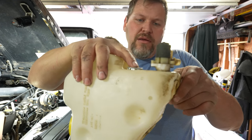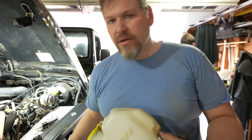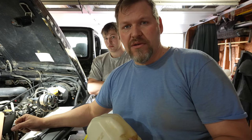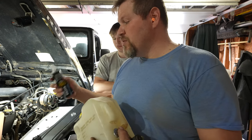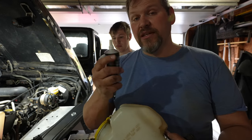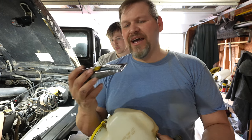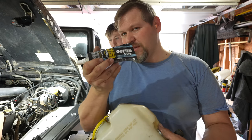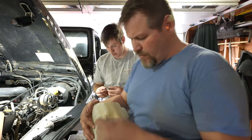It's about ready to pop in, but we need to seal it. We don't know whether to use silicone or JB Weld. I've had really good luck with JB Weld sealing oil pans, diff covers, anything like that, and it says it'll work on plastic. But we're leaning towards silicone because it allows a little bit of flex. This is actually gutter silicone — the kind you've had to take apart on gutters that's rock hard and sticks so well. It never leaks either.